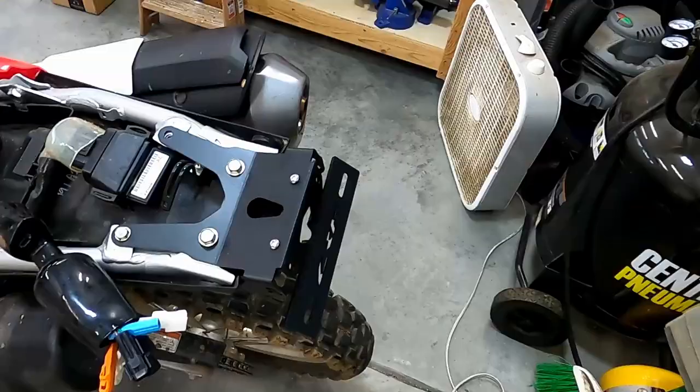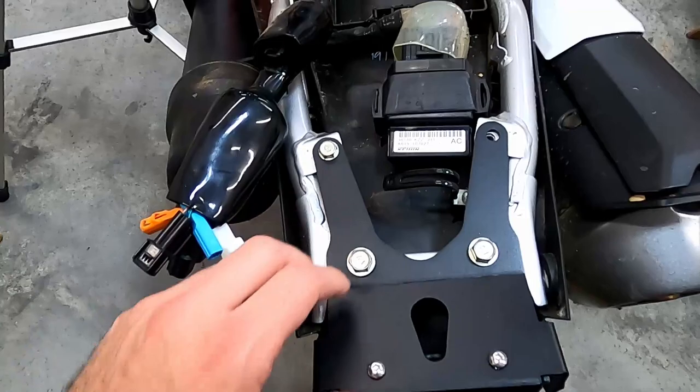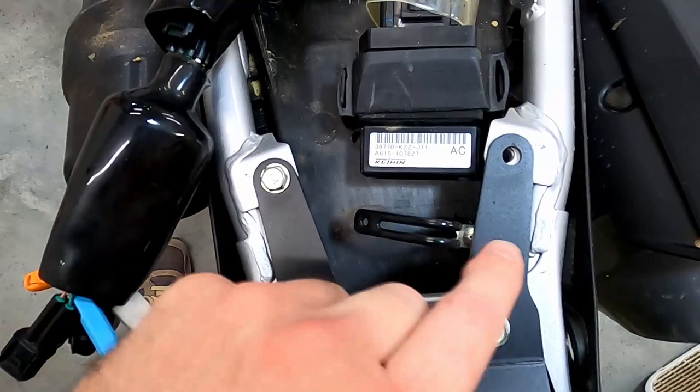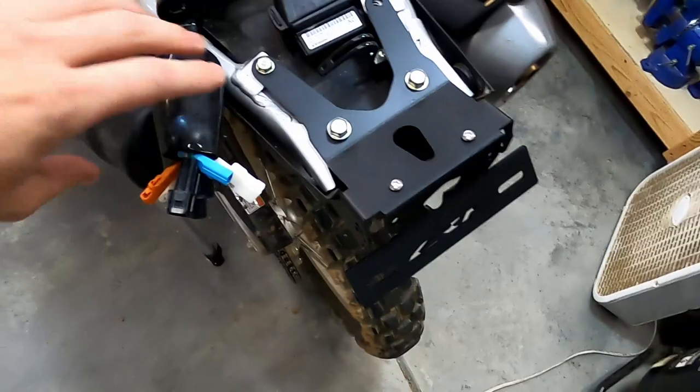The whole assembly comes off and we're ready to do some wiring. I'm test fitting a few things — it's probably easier to show you without all the wiring in here during the final install. I had already seen this complaint online: these are the four mounting bolts that hold the bracket assembly to the rear subframe. When you get three of the four bolts in, this last one is off ever so slightly. So I'm going to use a drill bit — probably a step bit — to open that hole up just a little bit.